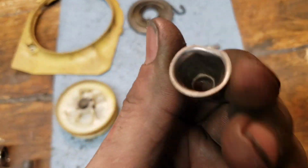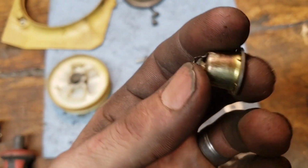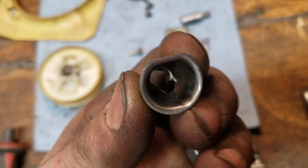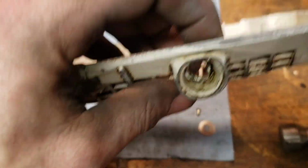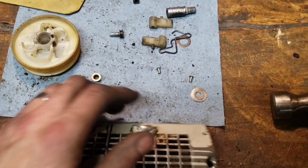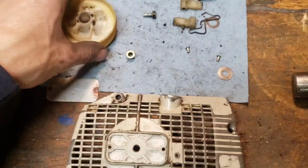And it's been a long time since I've had to, to be honest, and I can't remember where I used to get them. I used to get these from somewhere else, not Stihl. But I'm going to probably call a buddy of mine. When in doubt, call a friend and see what he thinks about that. It's obviously worth saving the recoil. I've even seen people just run without them, but it wears away this aluminum. There's a generic company that makes them. The badge, I'm going to get a new one for them. I might make one like I did for my nitro saw.